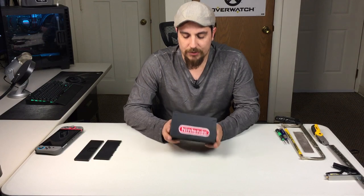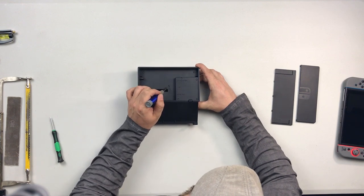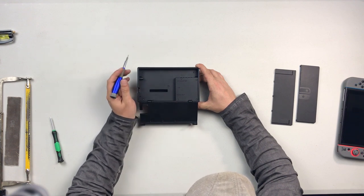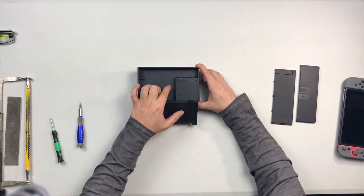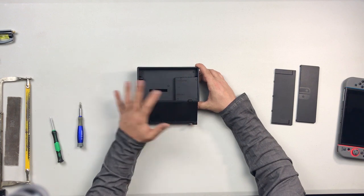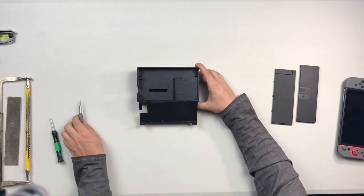The first thing you're going to want to do is you need to have either a screwdriver for the back here. This is a Nintendo tri-wing security screw. You're either going to need to have that physical type of screwdriver, or you could use something like a small flat blade that'll fit in between two of them, or even a sharp steak knife — something with a point on it that you can get in there to get those six screws out. They're not that hard to get out.